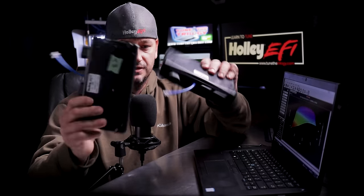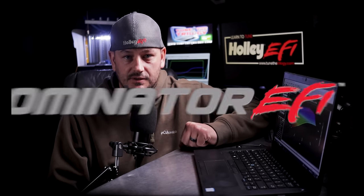I mentioned I just ordered an ECU for myself. Even though I have plenty of ECUs floating around, they're all Terminator X's. It's probably no surprise that I picked a Dominator for my own car. How I came to that decision: number one, the car is drive-by-wire, which left me with the choice of either Terminator X Max or a Dominator. The primary reasons I went with the Dominator are I wanted the ability to run an NTK sensor, I wanted all of the inputs and outputs the Dominator offers, and I really wanted the internal logging and adjustable sampling rate.